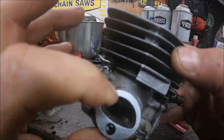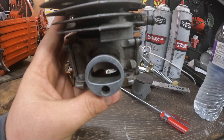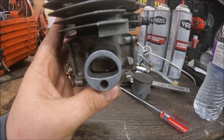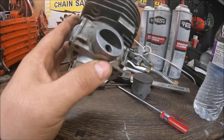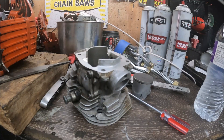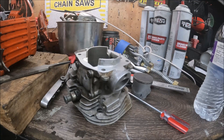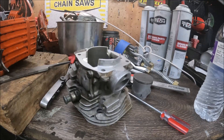We will lower the floor on this one at least a little bit. You can see there's at least a little bit of plating overhang — probably 10 to 15 thousandths at most — and we will blend that down. Then I'm going to take the piston and cut a half-moon notch in the bottom of it to hit our desired intake timing. I'm shooting for an opening of around 78 degrees. If we hit 77 or 79 it'll be okay, but I want to get as close to 78 as I can.